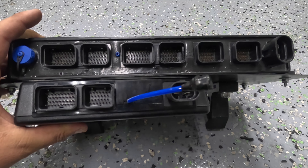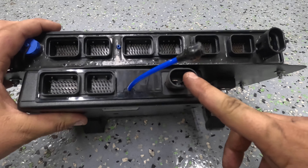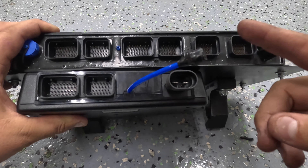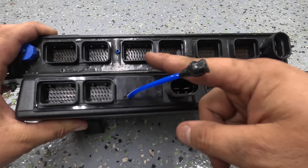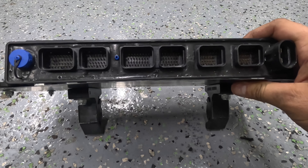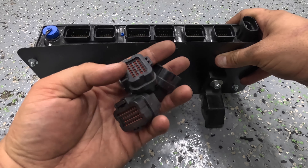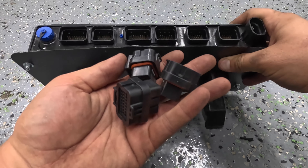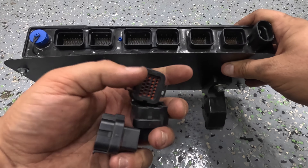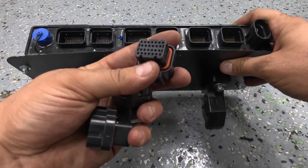You can carry over your wire harness from those connectors, but when we look at the software side you'll notice some differences in capabilities. The power plugs are the same, so that's something you get to retain. However, the Terminator is missing all the I/O channels that you have on the Dominator ECU. If you want to use those, you'll need to purchase additional plugs — I bought mine through ProWire, but you can get them through Holley and other vendors. They come un-terminated, so as you set up your software you'll wire your pins based on your needs.